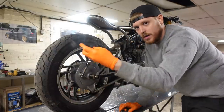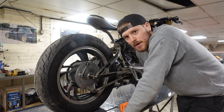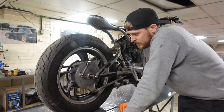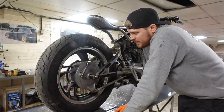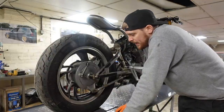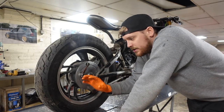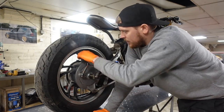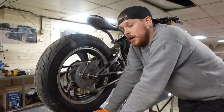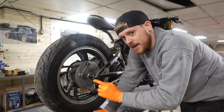The other one was we were going to cut some bits of aluminium, put them into there to cover that spoking so it is no longer through. It is a solid spoke, which would have been a great, nice design idea, I think. Might have been a bit of a pain to carry it out, but I still wasn't quite happy with it. So did a bit of looking on the internet and things, and the second generation XV750, the rear wheel's got straight spokes. Although, that wheel is a 15 by 2.75 wheel. This one is 16 by 3.